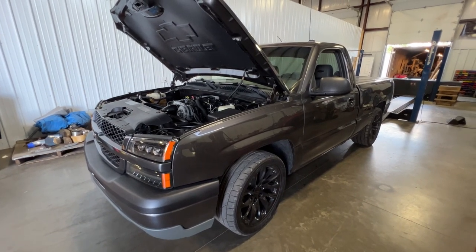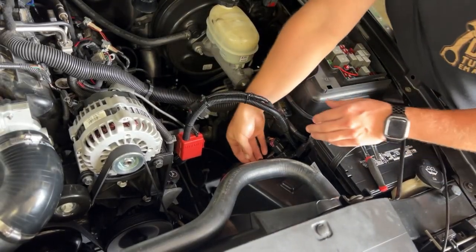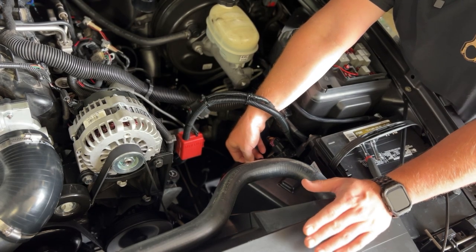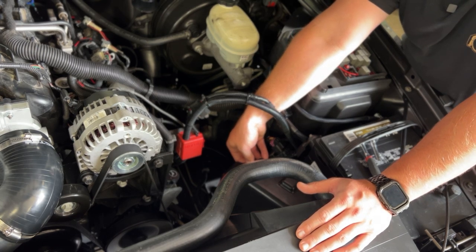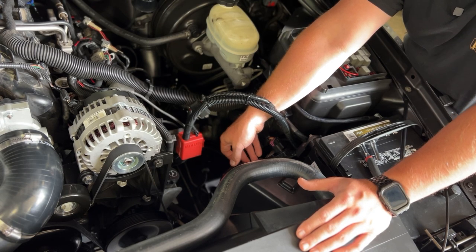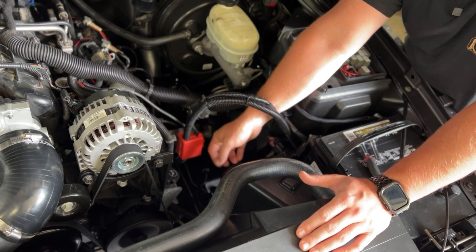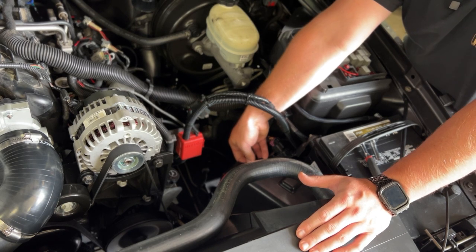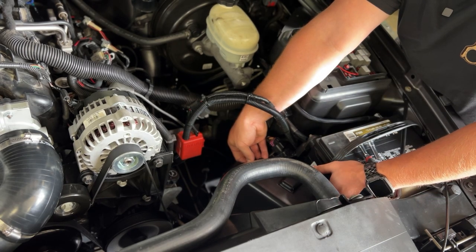Let's do the read file. On this one, I'll pull the ECU and pull the read file off on my bench harness. Some of you may be wondering why I'm pulling the ECU. On the 2003 to 2007 classic trucks, the ECU is known to brick. When you're doing a read file, you either do a low speed read with a couple of fuses pulled — good chance it reads okay but takes 15 to 20 minutes — or you pull the ECU out, do a high speed read, and you don't have to worry about anything. I always pull the ECU; it makes my job easier.